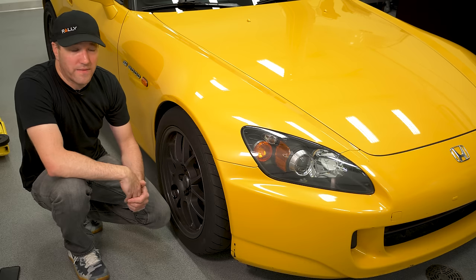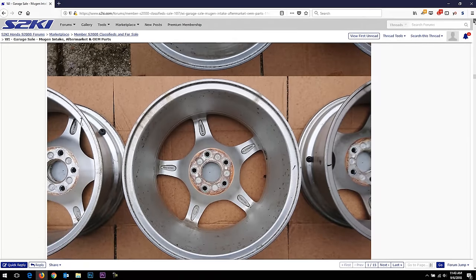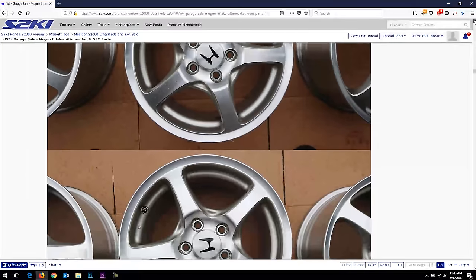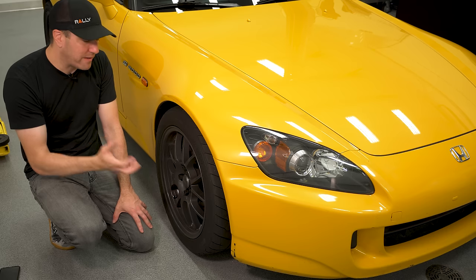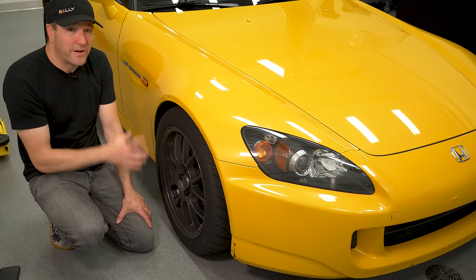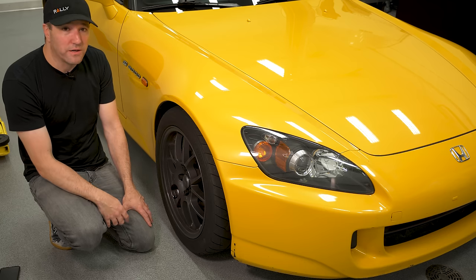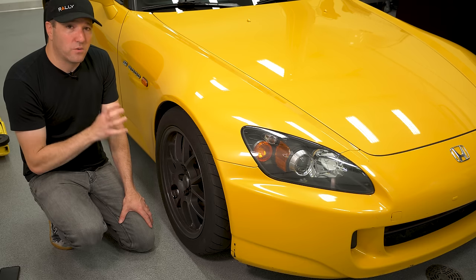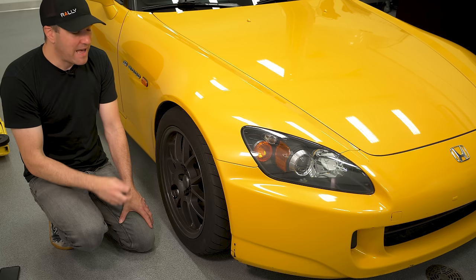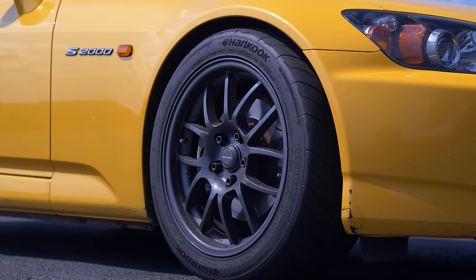The wheels are more important. On a stock car from 2000 to 2001, they had a silver cast or silver painted wheel. In 2002 and 2003, it was the same wheel but with a bit of gold metallic fleck in the paint. From 2004 to 2005, you get the AP2 wheels, identical between both years, and then they changed them again. Look closely at the wheel condition — if one is in immaculate condition and the paint color seems slightly off, that wheel has probably been refinished, so look carefully at that side for any damage.